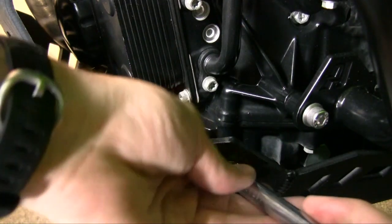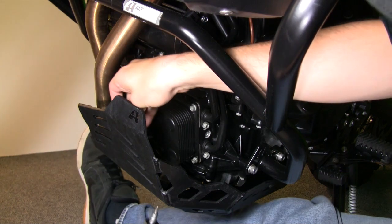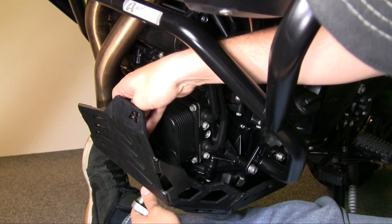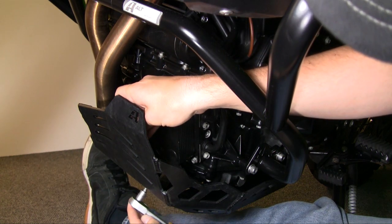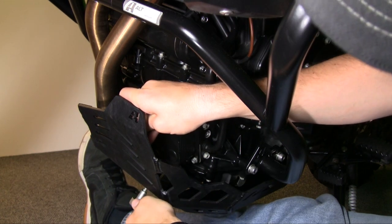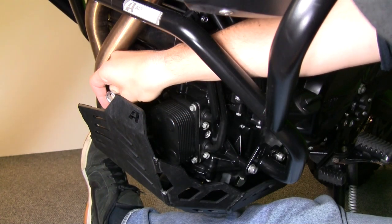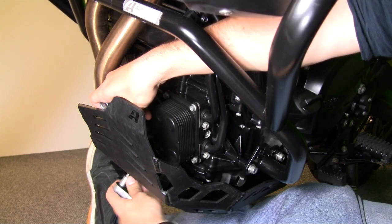Using a 13 millimeter spanner and a 5 millimeter Allen tool, hold the mount bracket nuts as shown and tighten these fasteners down. Careful not to strip these heads — just get it tight and you are done here. Once you've gotten this tightened down the first time, you should never need to do this step again. If your plate takes any really big hits, the vibration isolation mounts may shift and affect your alignment. Otherwise, leave this as is and only remove the through bolt and the four vibe ISO nuts when doing oil changes.